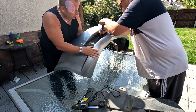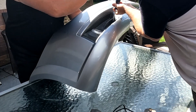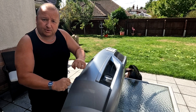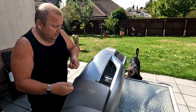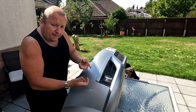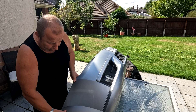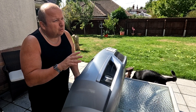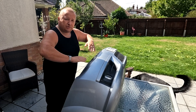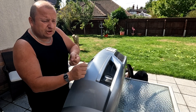We're just going to screw this little black thing back in, folks. I only actually sprayed this part of the bumper — we didn't spray any more than that, so all the rest is as it was. One thing I found out: I've got that plastic weld gun with the little staples. We tried to come from the back and melt through, giving it a little quarter turn — it's supposed to secure plastic bumpers together with a little wire metal strap. That didn't want to take on these for some reason. This type of bumper is really flexible, so it just sort of melted. I think they're okay for ABS bumpers, but this sort of very flexible type, they didn't want to take.